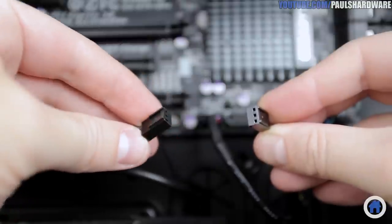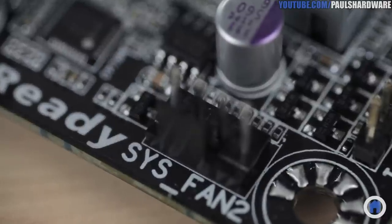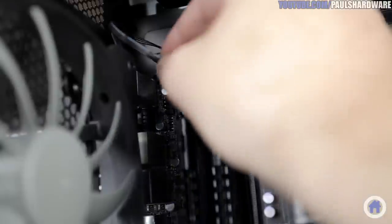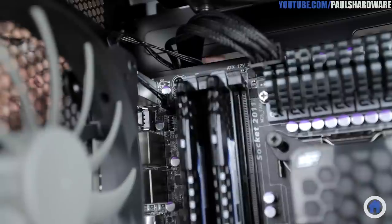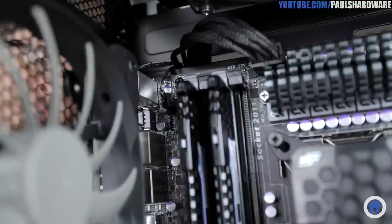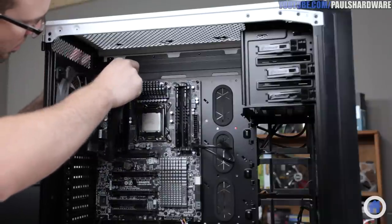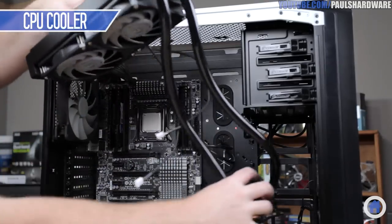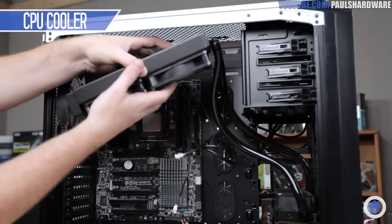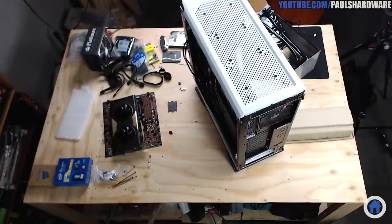About this time, you can also plug in your case fans to the 4-pin headers that aren't labeled CPU Fan. I am skipping the case's built-in fan controller in favor of direct connection to the motherboard. I'll also be using the fan power splitter provided with the H220, and I will tie up excess cables next to the fan or tucked back behind the motherboard tray. I'm going to connect up the black 8-pin CPU power extension now, because next up is CPU cooler installation, and the radiator from the CPU cooler could potentially block access to that plug.